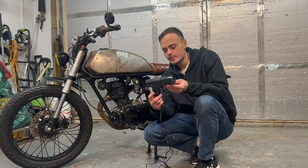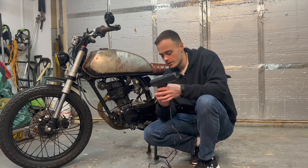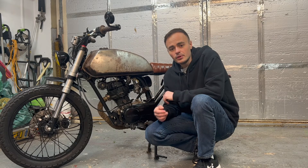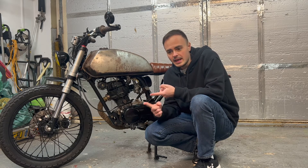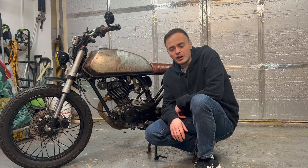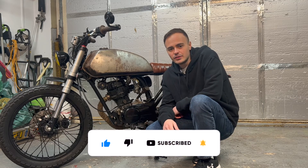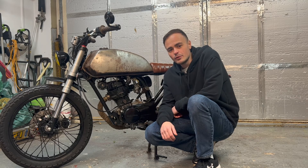In terms of reviewing this timing light, it's a very basic unit but it does the job — the light's bright enough to see the marks on the flywheel and the leads are fairly long. I'll put a link to this in the description below if you need to get one. Now that the engine's timed up nicely it should start much easier, you're going to have better fuel economy, and you're also going to have better performance out of the engine — so it's definitely worth doing. If you found value in this content please give the video a thumbs up, consider subscribing, and click the alarm bell for notifications when I post new videos.